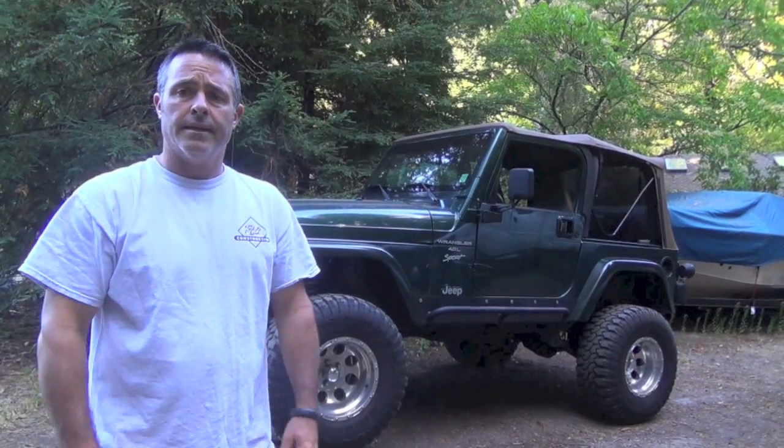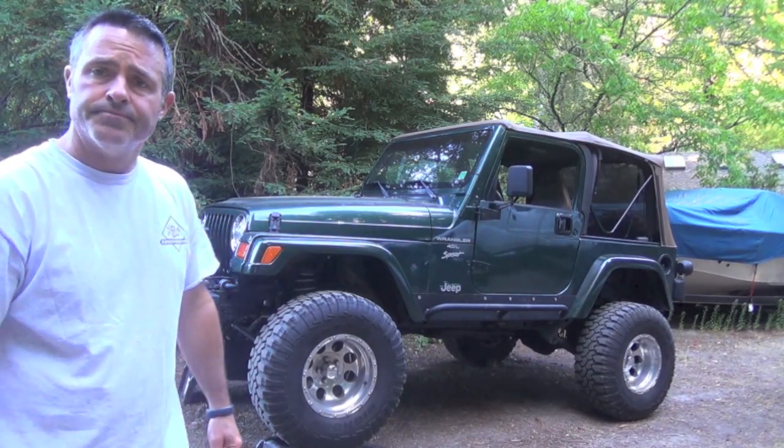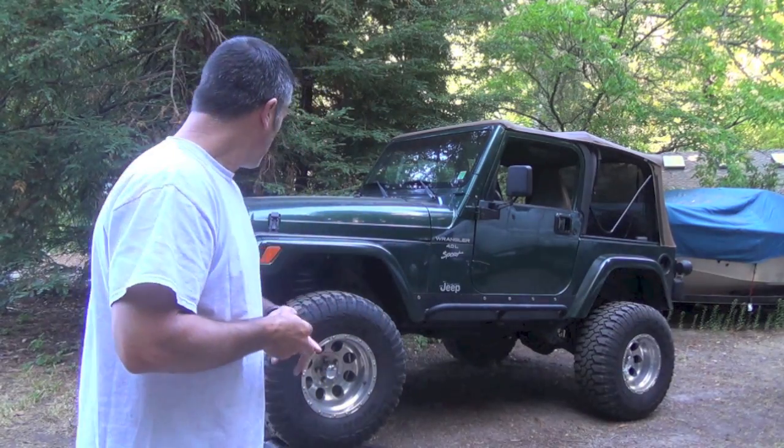Okay, and that's it. Short and sweet. Just wanted to tell you what I've experienced and what ended up working for me after taking this vehicle apart. I'm going to go with control arms first. So definitely check those bushings, work your way back. The steering box was the most expensive, and then obviously check that everything's tight and the adjustments, and then when you're all done, get a front alignment, and hopefully everything will be good.